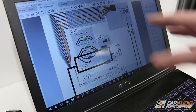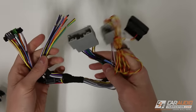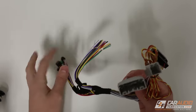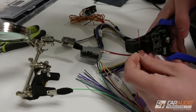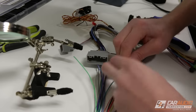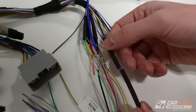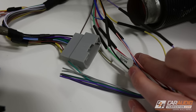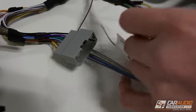Read the manual before you start the install. The most important page gives us all the connections we need to make. Because we've got the T-harness made by iDataLink, this is actually going to be super simple — these are all just plug connections. The only connections we really need to make are to the aftermarket radio itself. To connect the Maestro's harness to our new radio harness, we strip the wire, apply a heat shrink tube, twist the wires together, and then solder them. We just use the instructions and connect the wires based on their wire colors.